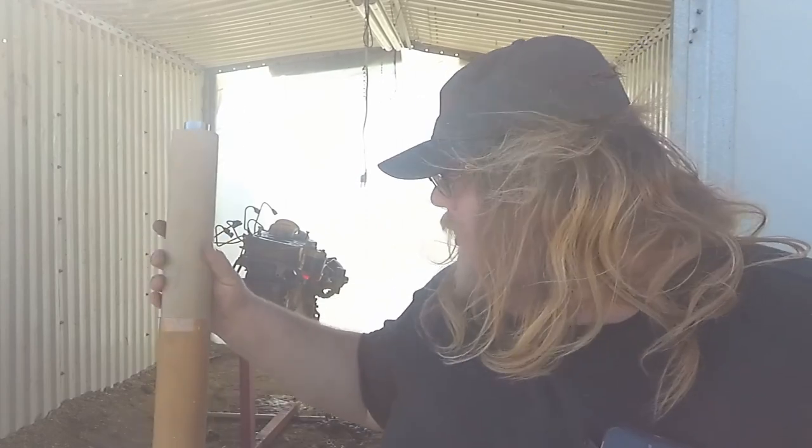Okay, so I'm back here the next day, and I got my new camshaft right here in this tube. I'm getting ready to put the gear on it, along with the gear on the crankshaft. I got both gears in the oven right now, heating at 500 degrees, so I'm hoping they're going to drop on pretty easy. This morning I also got a piece of plastic and some old wood, and I put plastic over the back side of my building, as you can probably see.